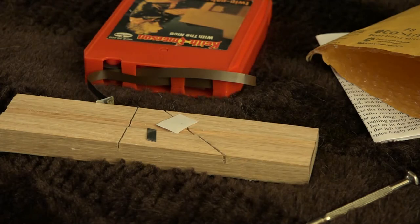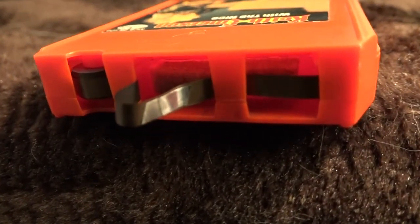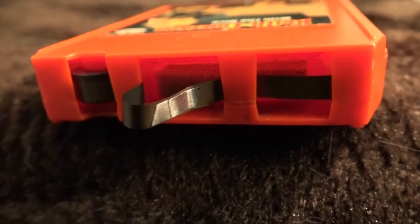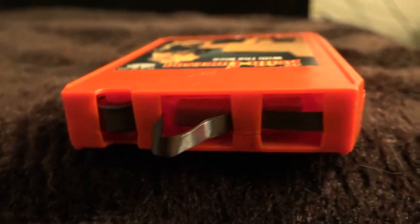I've got a piece of aluminum tape — a tiny little thing I have to try and get the backing off — and another piece of clear tape on a white piece of paper. The aluminum tape doesn't look like the right thing; it's not wide enough and looks more like burglar alarm window tape from back in the day. I guess I need to buy better supplies next time. Here's what the finished repair looks like: the silver tape over the quarter-inch magnetic tape, and behind it some clear plastic tape attached to the other side to make it mechanically stronger.